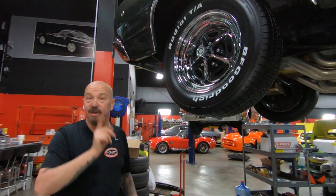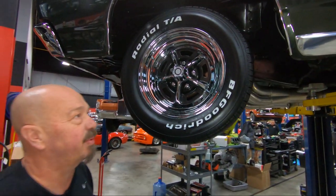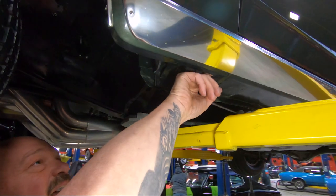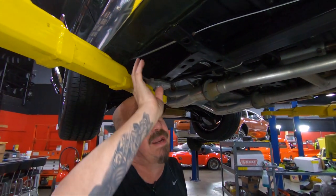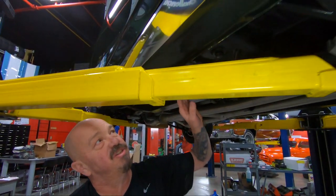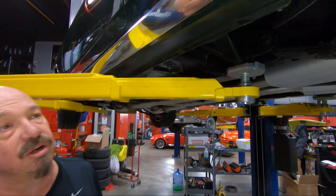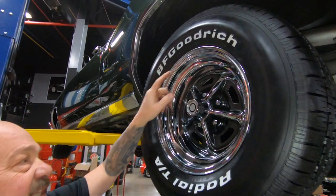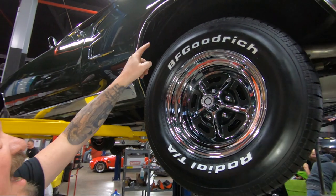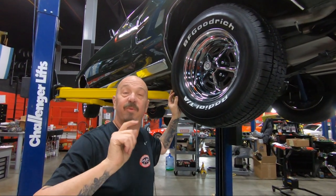Now you're going to have to get up in there with the garden hose and scrub brush whenever you take this thing out and make sure that gets clean again. This thing is sweet. We got brand new Magnum 500s on it, 225-60-15s. As you work your way down the rocker, the rocker molding looks good. If you can get a finger in here behind the front fender — again, that's one of the spots it starts to rust — this one's nice and clean. The pinch weld is looking sweet. The bottom side of the rocker is just as clean as can be. Normally there's a mating surface right here where the quarter mates into the rocker — looks like somebody has smoothed all that out. Out back here, these Mopars are cool because you can put a lot of tire out back. We got 275-60-15s, brand new Magnums, new wheel lip moldings. And that wheel well there, looking sweet. And right here — this is where she does her talking right there, guys. Now we're going to get under the hood and see what's making it talk.